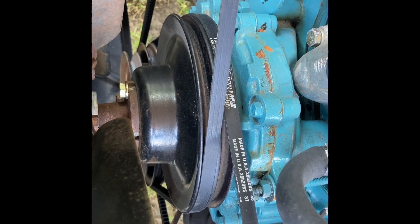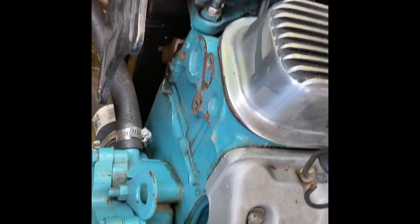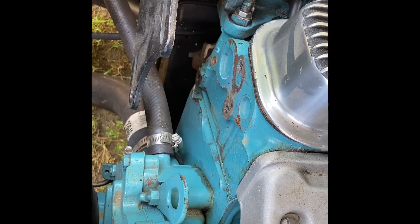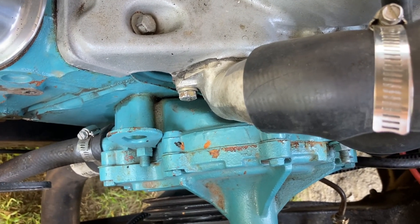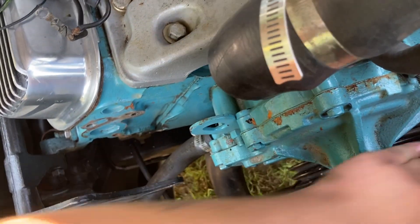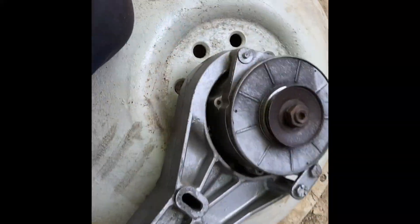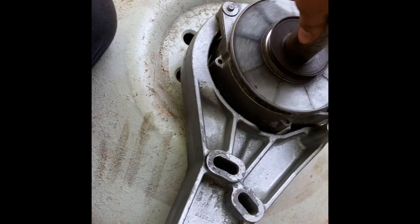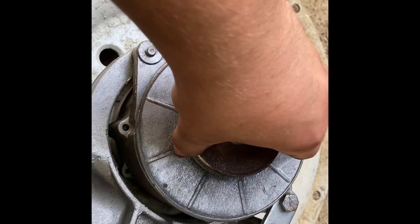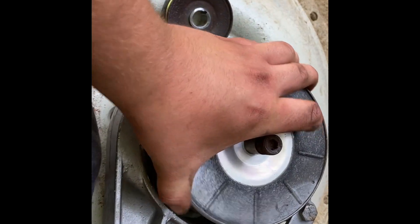I'll pull the water pump off after I drain the water and paint it once it's ready. I also want to get the alternator off to see what's up with it because I don't want a bad bearing ruining the belt and locking up. I'm going to check the bearings — either grease or replace them, it just depends. I'll take my water pump off after draining; it's just got so much play and I shouldn't be able to wiggle it like this. I'm going to take this impact with a 15/16 socket and zip this pulley off.